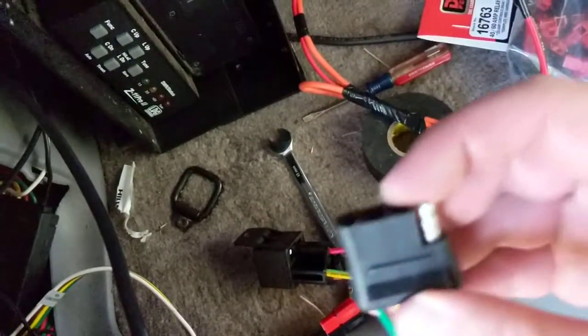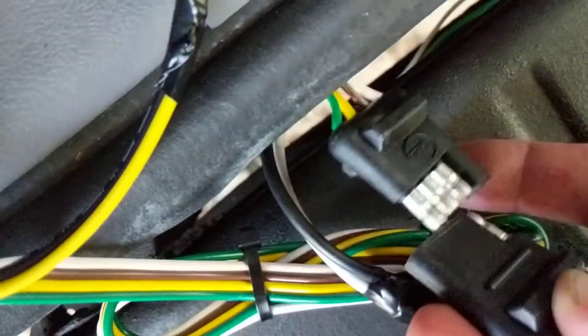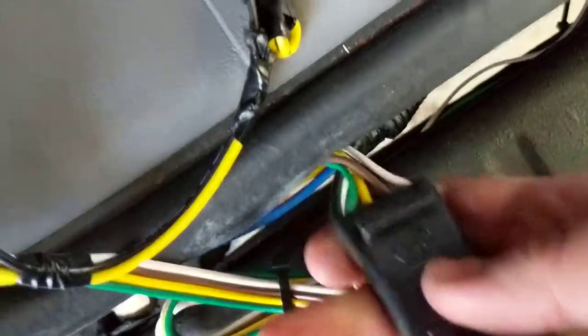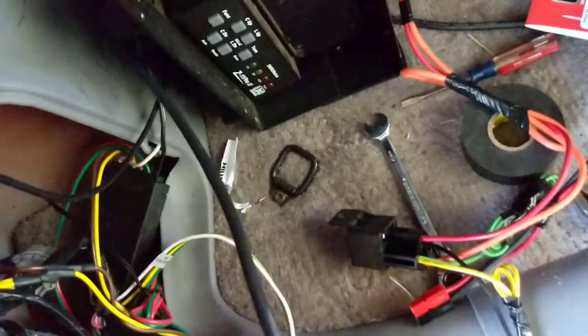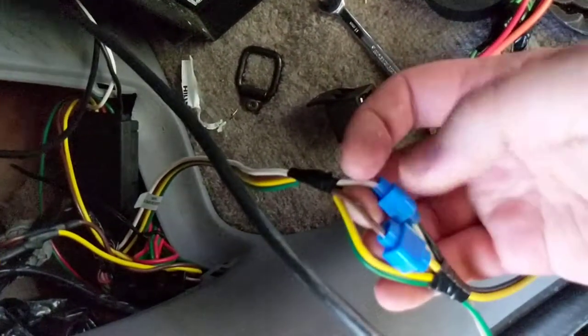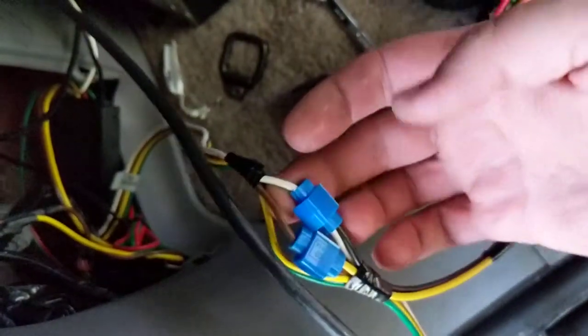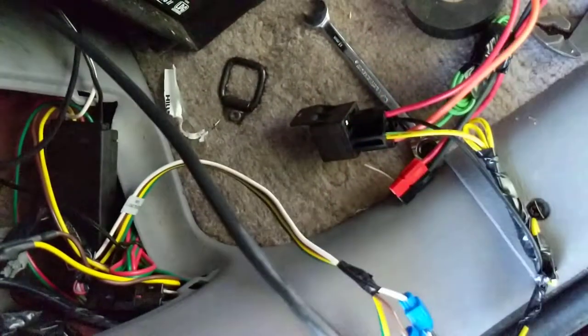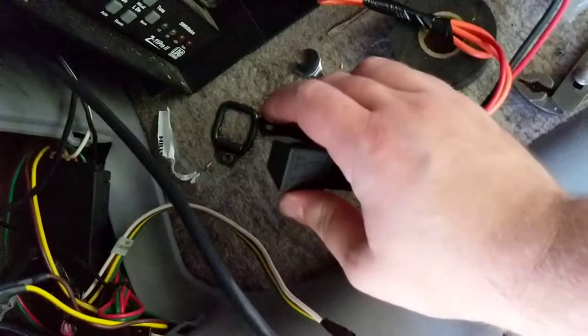Following it all the way to the connector, the bare pin is your ground and the one right beside it should be your running lights. So when I turn on the lights in the vehicle, we're going to have current on this brown wire because it's going to want to turn on the marker lights on the trailer. We ground from the ground on the flat 4 connection, and that will activate my relay.